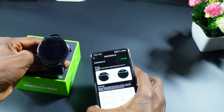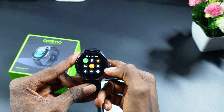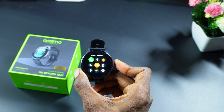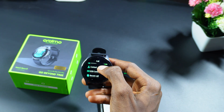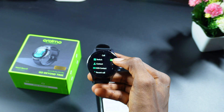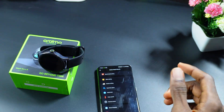If you want to turn on Bluetooth call to enable Bluetooth calling, click on the watch, scroll down, and click on 'Settings.' Go to that section, then click on 'Call.' From there, look for the switch and make sure it's turned on. This will allow you to accept calls right from your smartwatch.